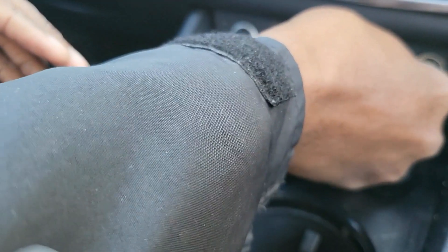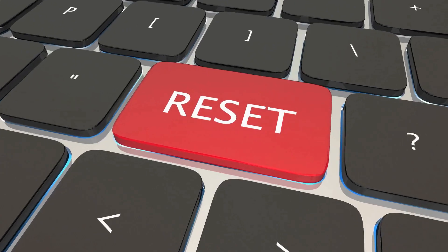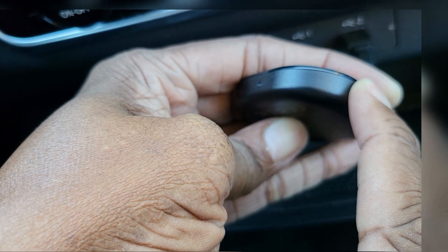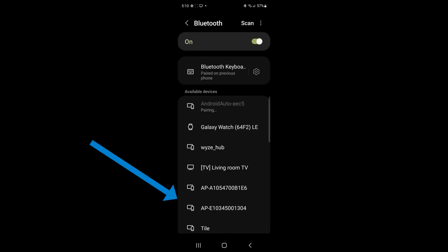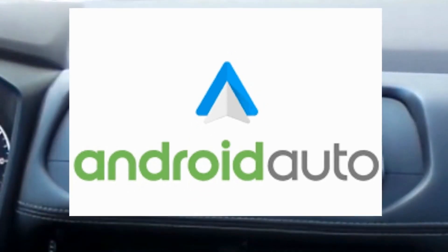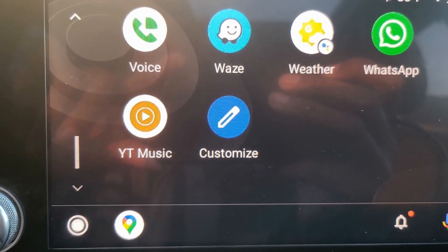Plug the adapter into the car's USB port. The light on the adapter will show white, indicating it's powering on. After a few seconds it will flash blue, letting you know it is unpaired and ready to go. If it is not flashing blue, use the chapter links below to skip ahead where I'll show you how to do a factory reset. Even though it's flashing blue, it's not yet in pairing mode. Push and hold the pairing button on the side of the unit until the LED flashes blue even faster. On your phone's Bluetooth menu, push the scan button to see an updated list of available devices. You'll see the adapter listed — go ahead and select it. Your phone will prompt you to confirm; press the pair button and the pairing process will be complete. After a few seconds, your car's display will acknowledge that a new Android Auto device has been plugged in, and you now have Android Auto working wirelessly on your car.